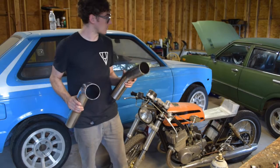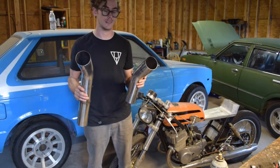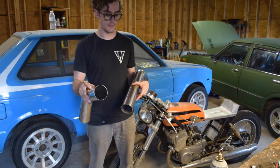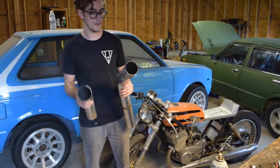We've got a lot finished on the Corolla. We're starting to work on the exhaust. Right now I'm making the downpipe. I'm going to cut this off — it's a slip fit — and then I'm going to put a V-band so I can connect these two. Let's get it.